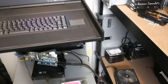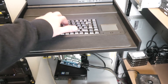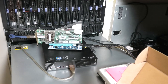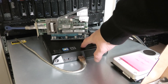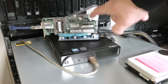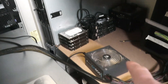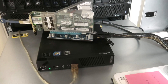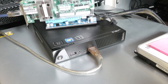You put in the keyboard and it blinks, and something is happening - maybe it got it now. Finally. Maybe I should recap what we are actually doing here. We have this tiny Lenovo here - it's an M93P - and that one has an internal mini PCI port in there that we are connecting to this PCI Express external board here, which is being powered from this power supply over here. And we are connecting it only with a PCIe X1 port inside of the tiny Lenovo machine.